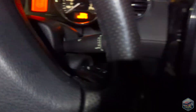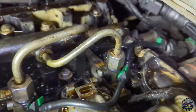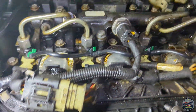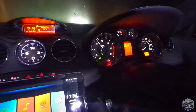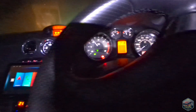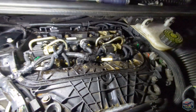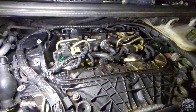She's lumpy as hell but I'm going to see what's happening. I'm not seeing any leaks — I'll let it burn off all the crap that was in there. I'm just revving her up to try and clear out all that crud because there was so much in that injector. After running for about 10 minutes, it's gone really really smooth and it's not going up and down anymore. I'm now going to take it for a test drive.